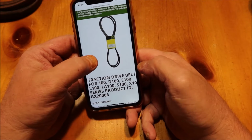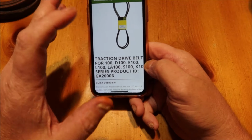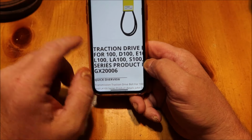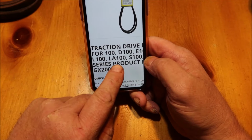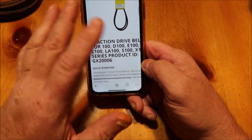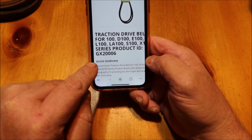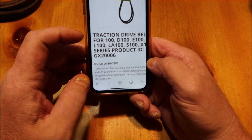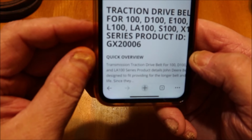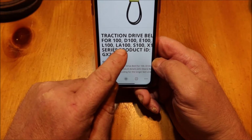Here is the actual John Deere website, and it's very confusing to me. Whenever you have the model number right here in the description, LA100, it doesn't tell you on the website that you have a serial number break. But here is the part number for what they're telling me I would get if I was to order that, GX20006. That would be the wrong belt for my LA100.